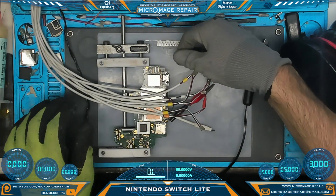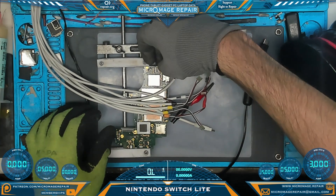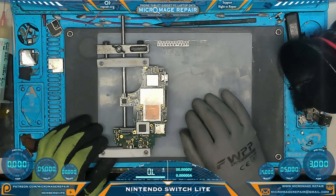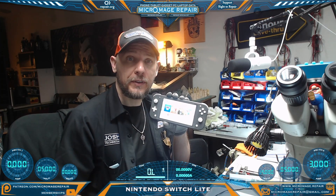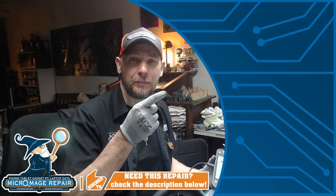We're going to hook up our modified iPhone squid, which we have retrofitted with Nintendo Switch Lite battery connectors. We'll activate with the OEM charger — in and out. What I want to see is a steady current increase without any hangups. That looks like it's booting to me. Our next step is to put this back in the housing and see if it boots up. And we're back up and running on their battery — it appears that our port change solved the issue. If you enjoyed this video, check out this one and I'll see you there.